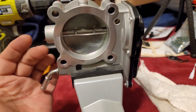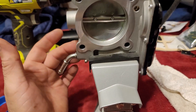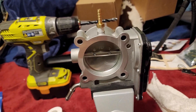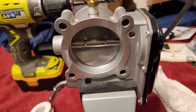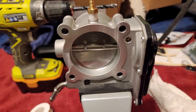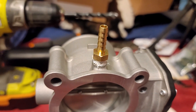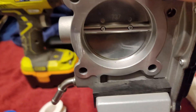This is the Elantra GT 60mm throttle body. You can buy them from a couple of different places — I got this one off eBay. You can also buy them from some import places but they'll charge you a few hundred bucks; it's basically the same part. If you shop around on eBay now, you can get them really cheap because inventory is back up. When I bought this it was during COVID so it was a bit more expensive. Make sure you get the Elantra GT one — the info sheet should tell you it's a 60mm bore; if it doesn't say that, keep looking. And just like that it's snugged all the way down, it clears, so it's not sticking out the bottom.